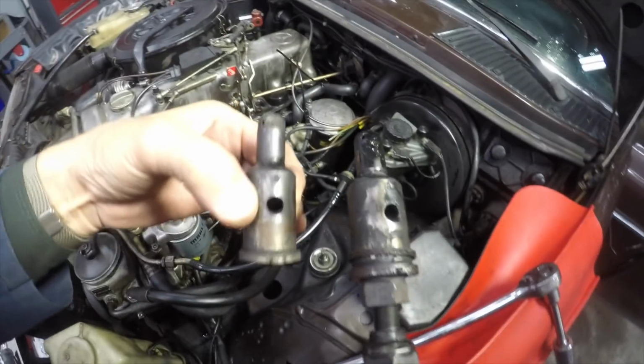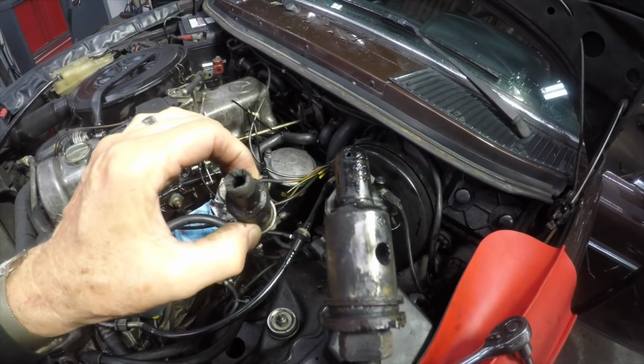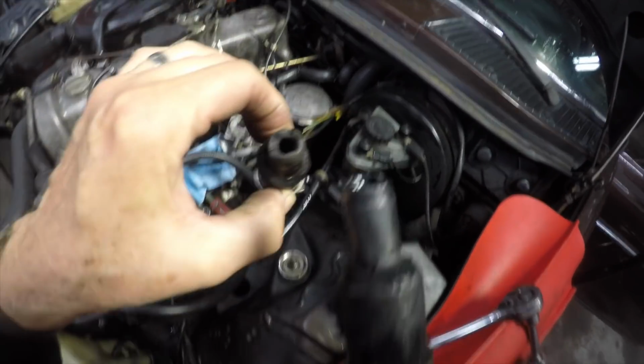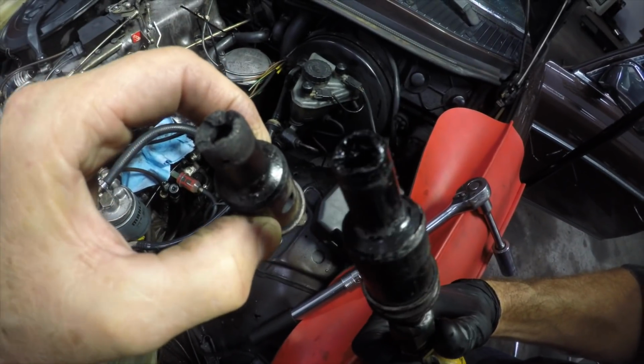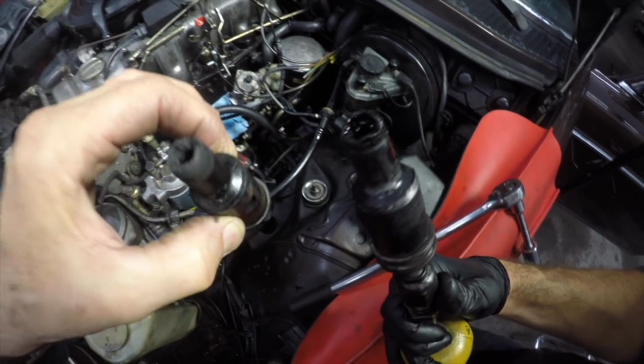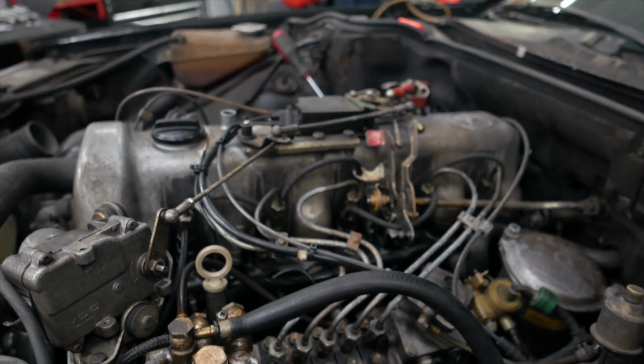Because we had mentioned some ideas off camera, but what do you think some of the causes were to cause 2 pre-chambers to do that? My gut feeling, because I've seen this happen a number of times with people, is somebody put gasoline in that fuel tank and ran it a while. You know, ran it a few hundred miles with gasoline in the tank, and got those combustion temperatures so high that it really did fatigue and crystallize those pre-chambers. I don't think anything other than extreme heat could have caused the damage we saw.